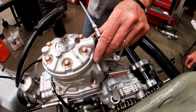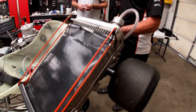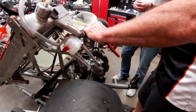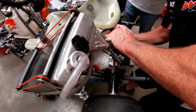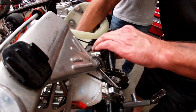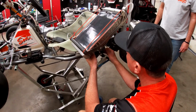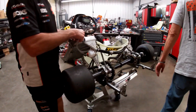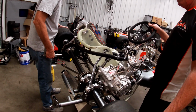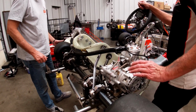Everything would take so much shorter if I could just see. So really, the coupler is kind of a preference as far as where it goes. Looks like you already had the plumbing right over here. We'll just stick to where that is now. So I'm just going to cut right where the other one was. Trying to get that water up higher than the rest of the engine so it'll burp out all the air. And interestingly enough, I don't need to add any more water.